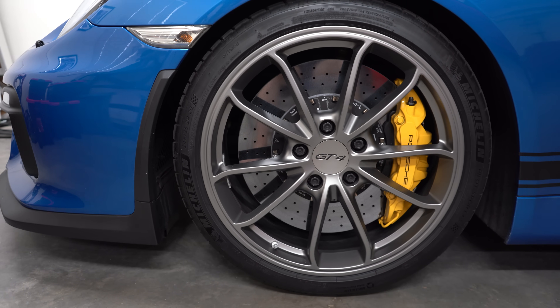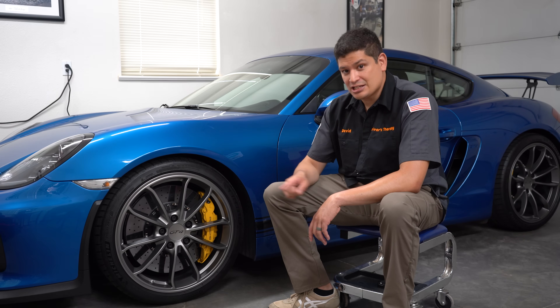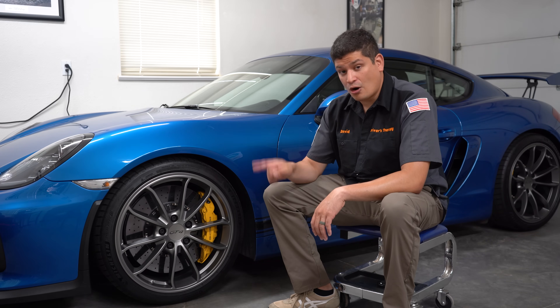Carbon ceramic rotors are extremely lightweight. If you think about carbon fiber, one of its great properties is that it's very strong and lightweight — the same concept applies to carbon ceramic brakes. They're very lightweight, which reduces rotational mass. Rotational mass means anything moving with momentum requires additional force to stop, and that produces heat. Steel rotors have a much heavier rotational mass, so they require more force and produce more heat to stop. Carbon ceramic brakes are lighter, needing less force and producing less heat.